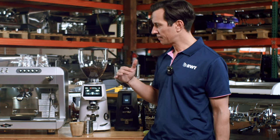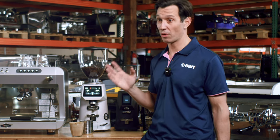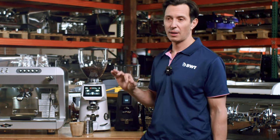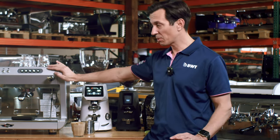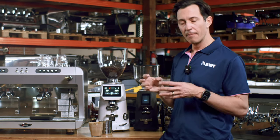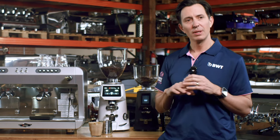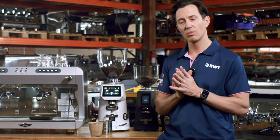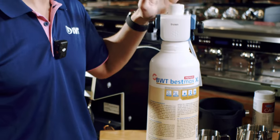One of the most important things when starting out is a water filter. Water filtration is by far one of the most important things — it's like putting oil in your car. If you run an espresso machine without a water filter, whether it's this machine, a Sanremo, a La Marzocco, or a Slayer, it's going to die. Hard water turns into scale — that white crusty form that builds up inside espresso machines. We have nine full-time techs who refurbish and service machines every single day, and we see the good, the bad, and the very ugly when it comes to people not using the right water filtration.